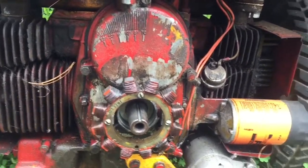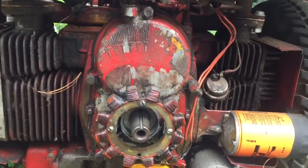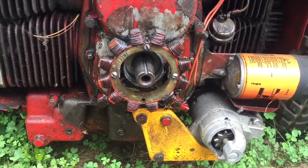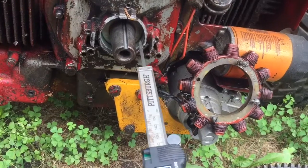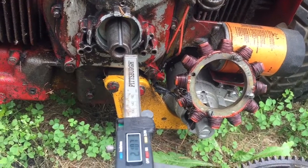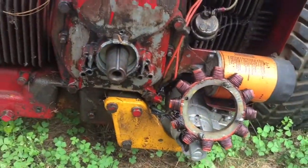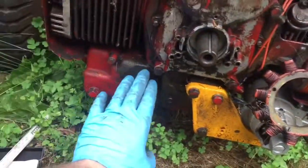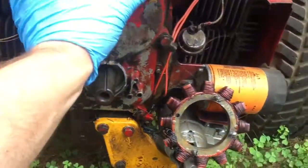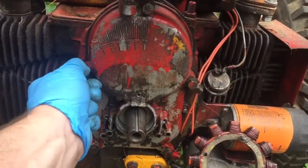I think I'm going to take a sharpie — or maybe I'll just measure in how deep this is to where the seal is right now, so we can have a better idea of the logistics of this issue. I just took my caliper here and measured in — it's 2.107 inches. Now I'll close this up and pull this timing cover off. The oil is down in the sump so there's no oil up here until it starts pumping and running.